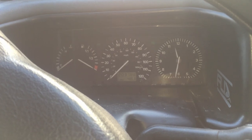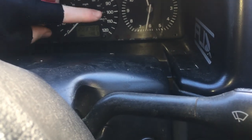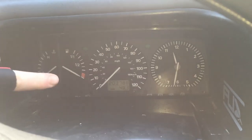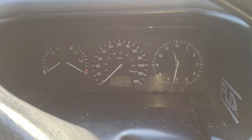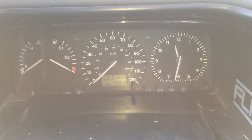T4s generally have three different generations of dash. The first one hasn't got this digital display — it's got dials that spin around on your mileage. That's the older 1990 to '96 model. This is the middle generation dash with the LCD display in the middle. These are more expensive to buy because people can upgrade from the first generation to the second, but you can't do it backwards as the first generation is driven by a cable for the speedo, whereas this is all digital. And then there's a third generation which is completely different to both.